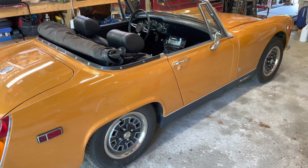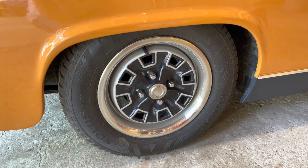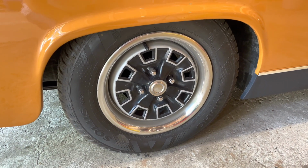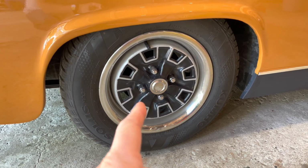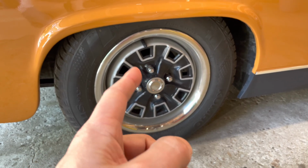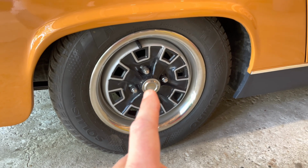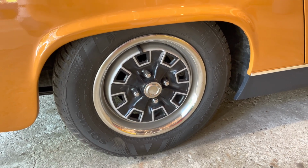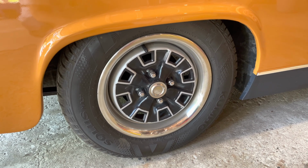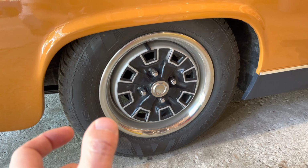In this video, I'm trying to determine why my car is bogging down when I give it gas to the point that it's undrivable at the moment. So the first thing I'm going to do is pull off this wheel, and the fuel pump is located just back here, and I believe there are two inline filters. One that came with the aftermarket electronic fuel pump, which is a solid metal one, and a clear plastic one.